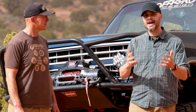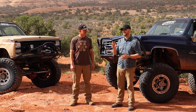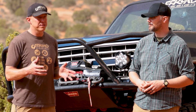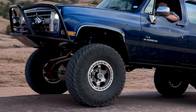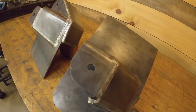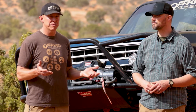So you've got the axle either set up or tacked, but ready to go nonetheless. Next up are the three brackets that weld onto your frame. The first step is figuring out placement for the link arm bracket, and this is where there's some freedom with our system. The biggest thing is you really want the link arms to be as flat as possible — that's the overriding big concern. That's what makes your truck handle the best. We have a range of brackets available and we'll work with you to get you the right ones.